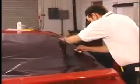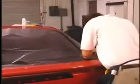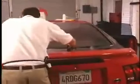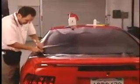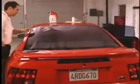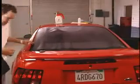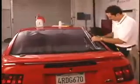Using this dry shrink method, cut the pattern about 1/4 to 1/2 inch larger on the sides and a full 1 inch larger along the top and bottom. This extra film allows for it to crinkle a bit on the edges during the heat shrink process, but still gives you area to trim off for a perfect installation. After cutting your rough pattern, center the film. Make sure that your H pattern is still moist and holding down the film to prevent it from moving on either side. After the heat shrink process, you will give it a final trim to match the window perfectly.